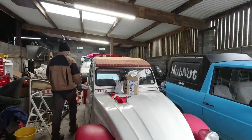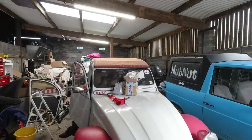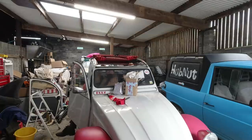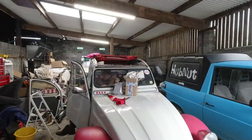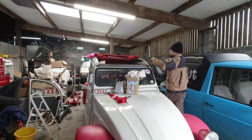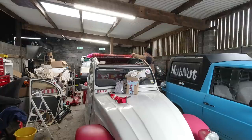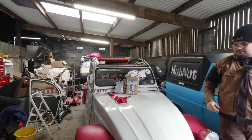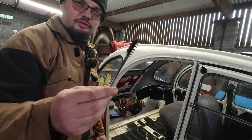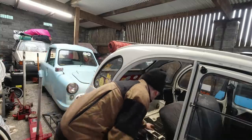We're demonstrating the 2CV's wonderfulness today. I've dropped the boot lid to get more light in the back. Undo the two roof clips here, clip the roof back, then bring the bar back and lock it down so it doesn't flip over and smack us on the head while driving — believe me, that's not popular. Undo a side clip there, and the other side, and then we can roll the roof back just like a sardine can. I've always wanted to get a big key to insert in the roof when it's rolled back. There are a couple of straps to secure it, but I won't bother since I've only rolled it back for more light while filming — just yet another reason why I love these cars.